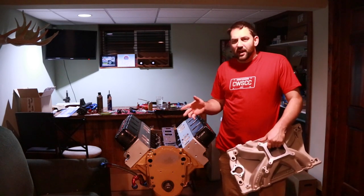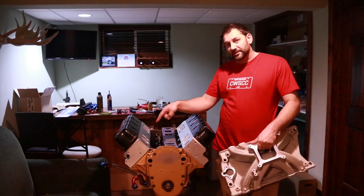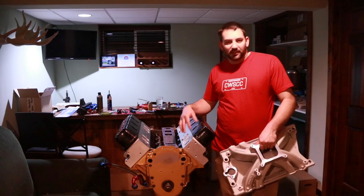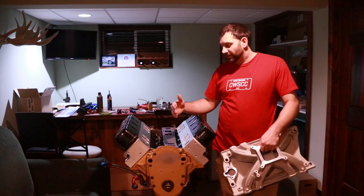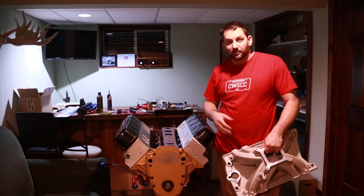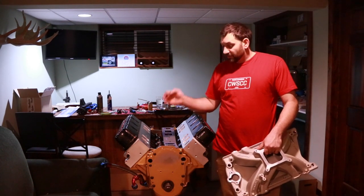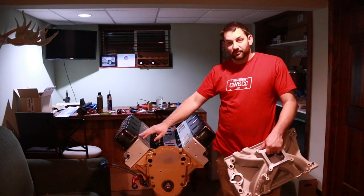That is to not cause any ledges on the way into the engine as air flows due to small differences in alignment, because if you deck a head, it lowers the ports, or if the intake manifold's a little wide or narrow or whatever, it can move the relationship of the two ports together. However, it is well worthwhile to match them up, at least on the sides and the roof.